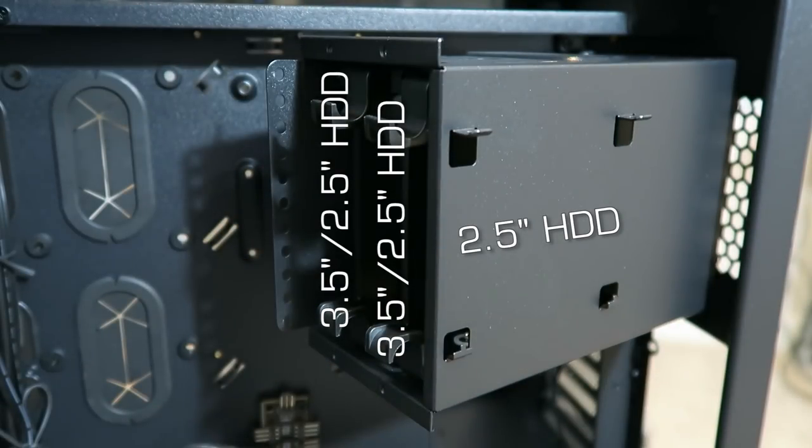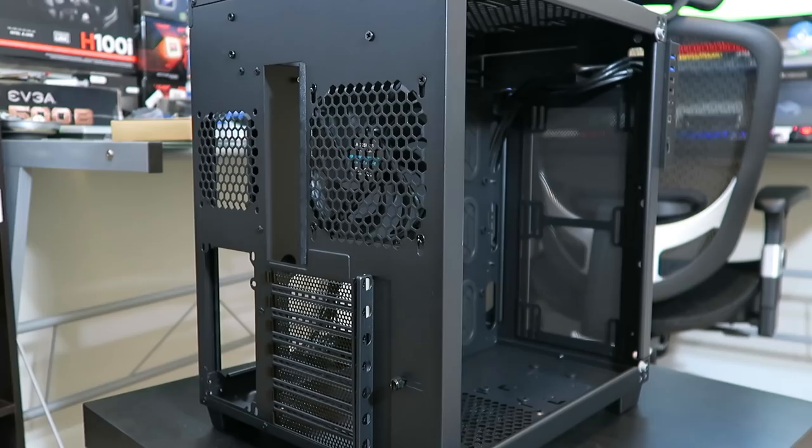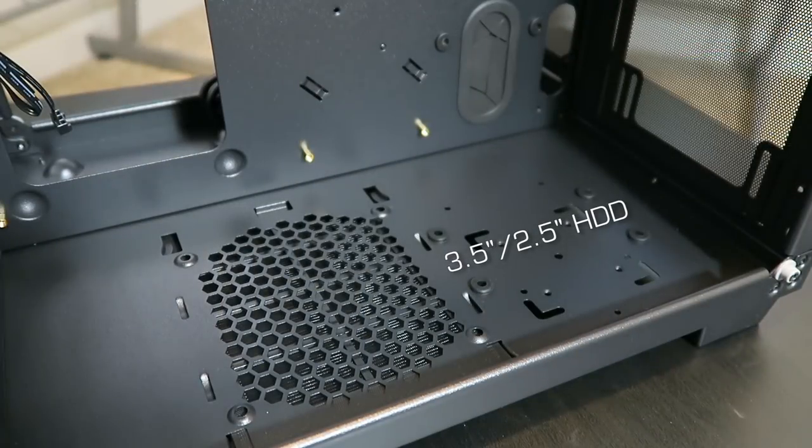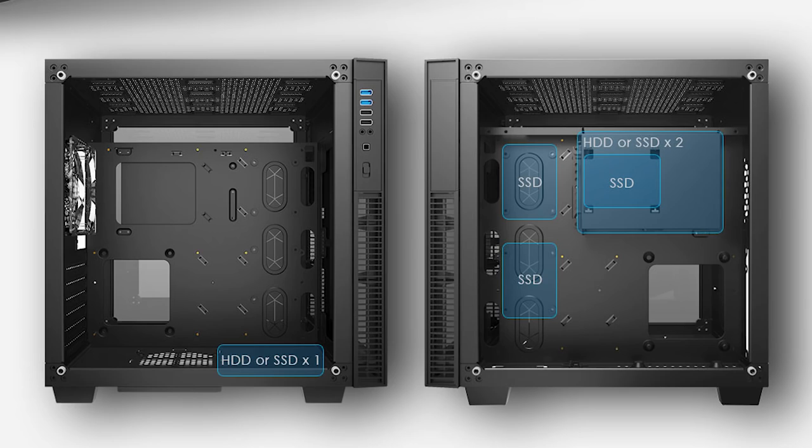On the side of the cage is a spot for a 2.5-inch drive, so this covers the first three drives. The remaining drives are a bit problematic: the last 3.5-inch drive has to be placed in the primary chamber near the front of the case, and the other two 2.5-inch drives have to cover up basically two grommeted holes' worth of space. Another issue is connecting power to these drives — it doesn't present a problem for the three drives at the cage since those are all right next to each other, but it does present a problem for those trying to connect the remaining three hard drives with one cable.